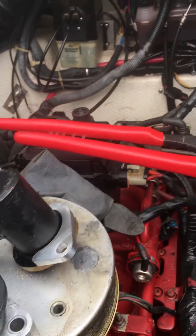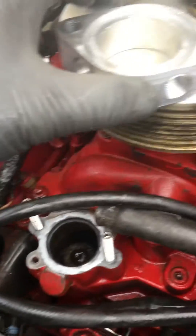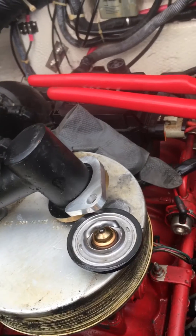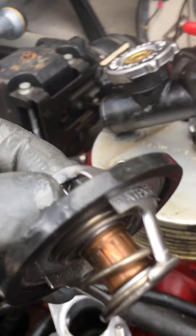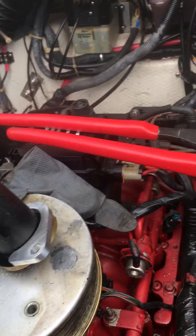Quarantine time. This is the housing — you're gonna put your gasket on down there. I usually lube my gasket with some kind of gasket sealant. This is the flat portion. This is your adapter that slides on. You're gonna grease up your thermostat housing — spring down. That's the part that heats up, that goes into your block.